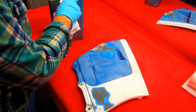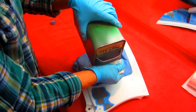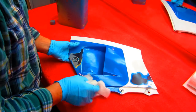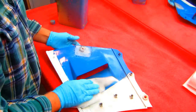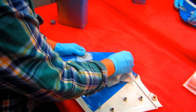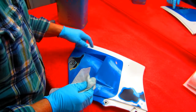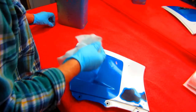One final cleaning with prep wash and we'll check which primers we like best. There is a distinct difference between primer filler and primer sealer. If you have primer filler there's going to be a lot of what I call talc or filler in it - it's not appropriate in some cases. It's probably good when you're doing a lot of body work, but on other projects where you're doing a minimum of body work that wouldn't be to your advantage. Anyway the test will be on the parts - this was definitely painted over again, I can see the tape lines and two colors of blue.